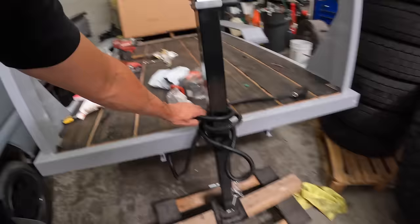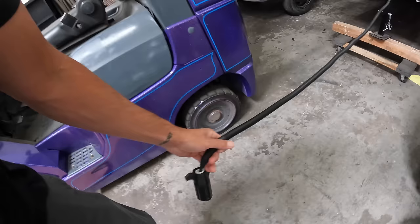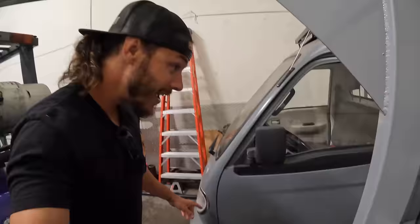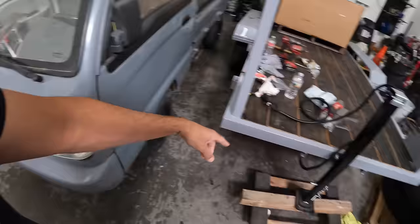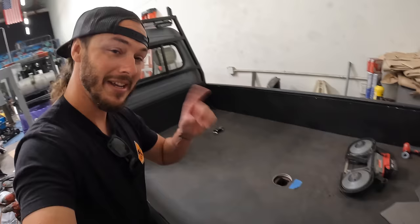For those of you concerned about me not running a plug in the dump bed — since this is a dump bed that's going to get used — I had Sergio build me a nice long whip, running the wiring off the front of the trailer. With this much whip we can turn with the gooseneck trailer and be just fine. We haven't tested the lights hooking it up to the mini truck, so I'm going to pull the truck out, flip it around, and test the lights.